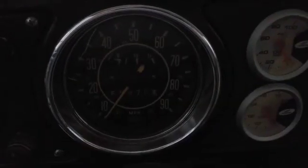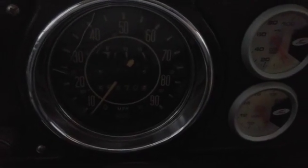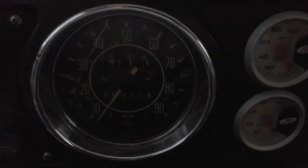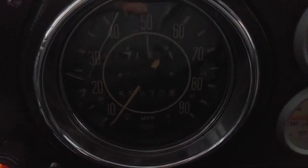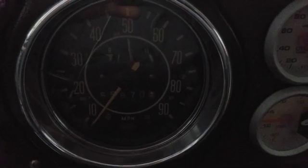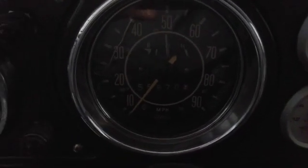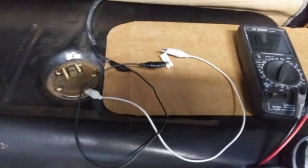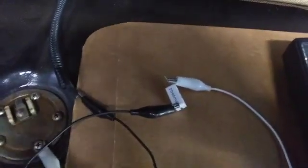This is a stock OEM gauge with a vibrator on it. Here goes the key — and you can see it climbing up. It went right to exactly half a tank, which is kind of unbelievable, but it really does work. You can hear my electric fuel pump running. Turning the key off — that proved the half-tank calibration on the gauge is really good.